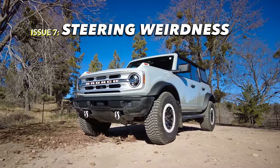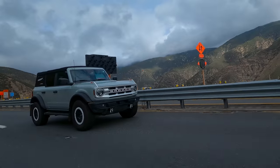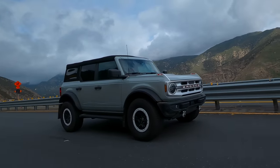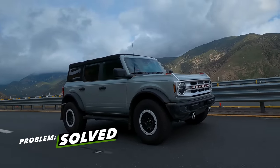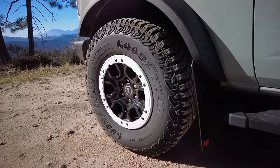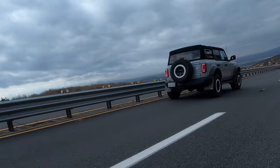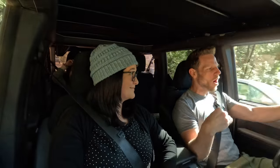One other esoteric issue that popped up when we first got our Bronco: there was some inclination for the vehicle to continue steering and not really return to center from left turns. I wasn't sure if that was a suspension issue or a tire issue, but as we've moved through tires it's become clear it really was a tire issue. This leads to another issue: the stock Goodyears have a nasty habit of being damaged by getting slashed between the tread blocks, as demonstrated in our Sierra Gordo off-road video.